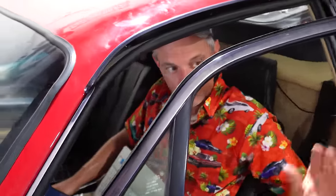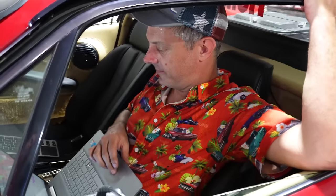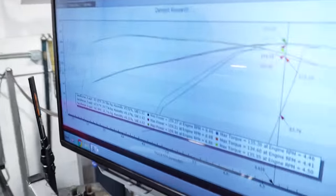So we've been finding some interesting things as we're researching this engine. Namely, the reported power numbers appear to be very Ferrari-esque. We've seen everything from 260 down to 202, which is what I saw for a naturally aspirated 3-liter that's actually 2.93 liters. But you figure that was with a fresh engine, which sounds like making excuses. You figure that's at the flywheel, and with probably 15 to 18% drivetrain loss, it's in the 165 to 170 range, or we seem to be stuck at around 160. So we're pretty much there.